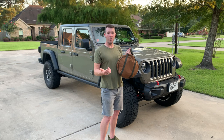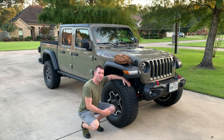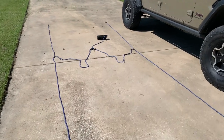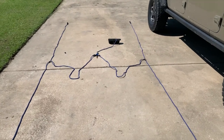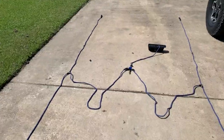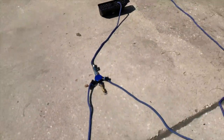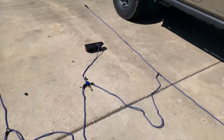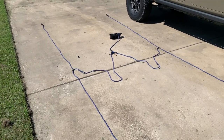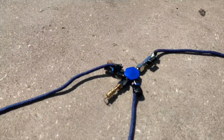If you want to figure out how to do it at home, stick around. And if you're wondering — yes, these are 37s. That happened. That is the mock-up of our inflate-deflate system. I went to the hardware store, got 50 feet of 3/8-size rope, and basically electrical-taped it to various fittings to simulate what I will do so I can finalize my cut lengths of my air hose before even beginning — measure twice, cut once. This will be the fun part of the project.